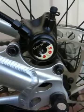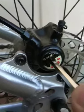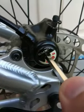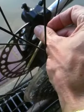To adjust the Hayes sole brake, put a wrench in here and tighten down this pad just about until it touches the rotor. Then do the same thing on the other side — put the wrench in here and tighten that one down until it just about hits the rotor.